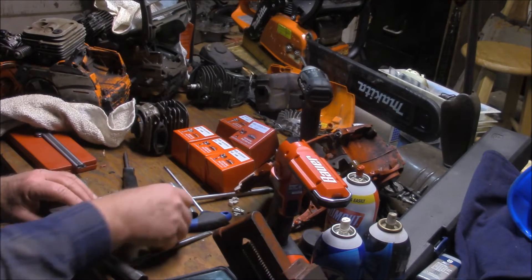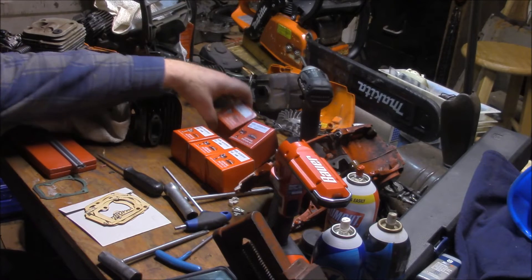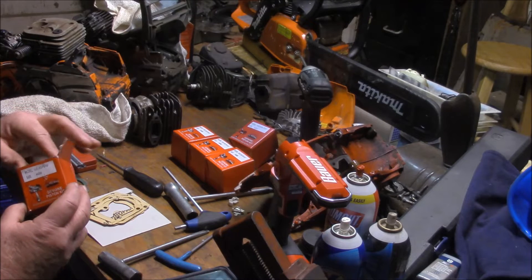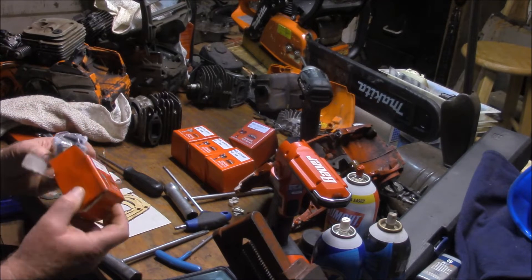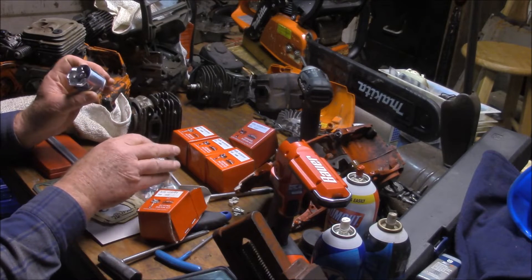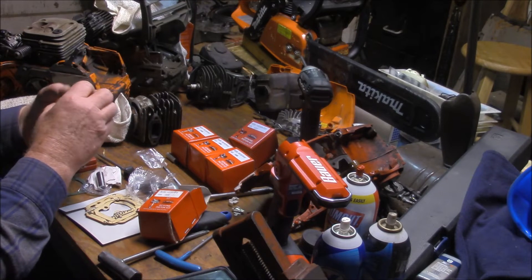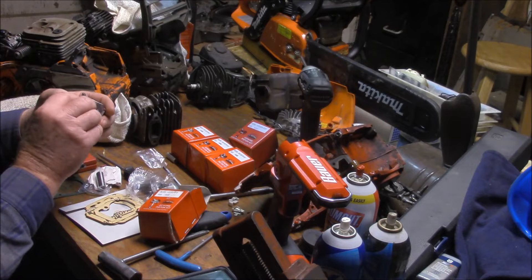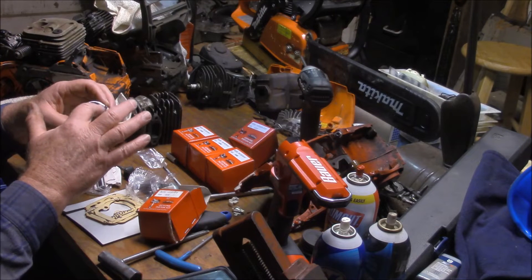Right alongside these thinner gaskets, I found that Little Red Barn pistons work pretty good as well. I know some people object to them because of how they're manufactured, but I've found these pistons to be reasonable. When I look at the uniform thickness in the bottom — whether one side is thicker than the other in terms of the casting — it's fairly uniform. I usually end up adding a little bit of intake timing, and I would clean up all the flashings around the inside.